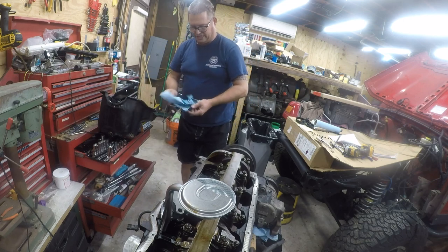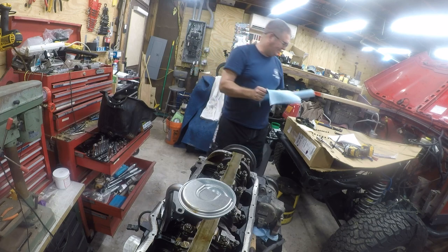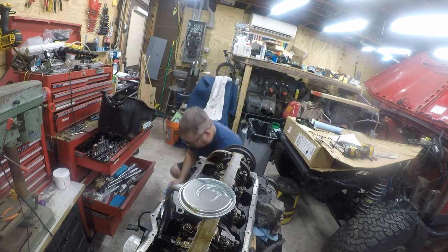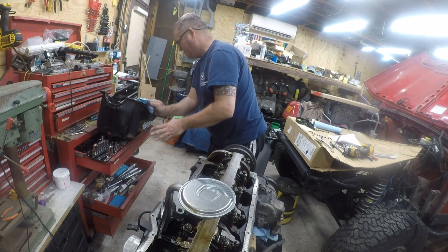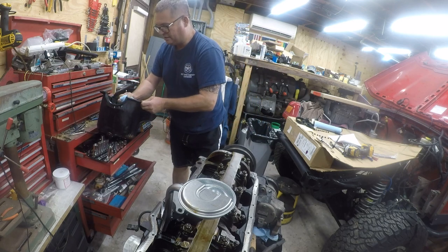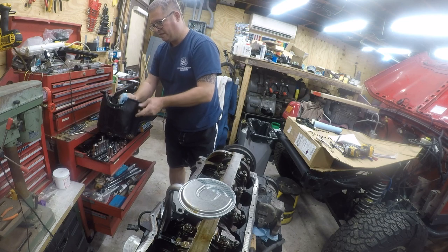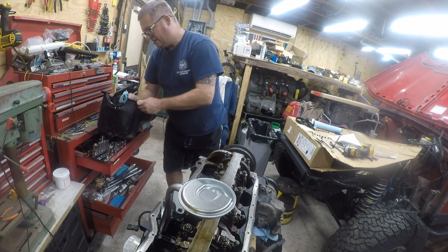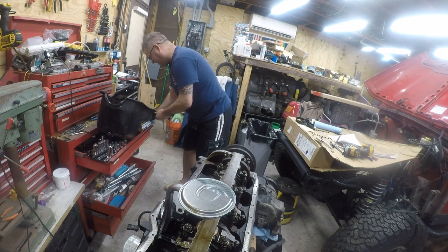I've seen all sorts of crazy, horrible things done on YouTube where people take abrasive pads and sandpaper and all sorts of bullshit to this, all of which is wrong. You know, it's a sealing surface, and if you want it to seal, you need to degrease it. Sure sign they've had problems with this before. It's covered in RTV.